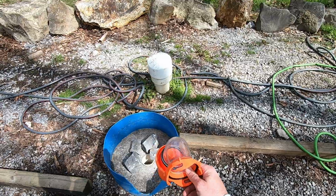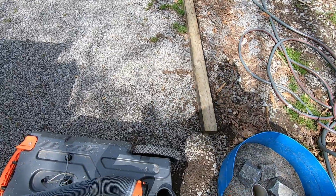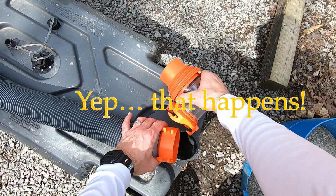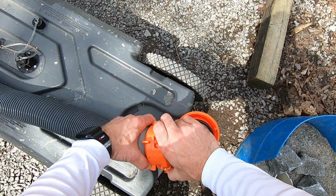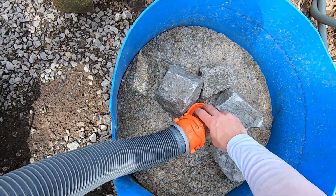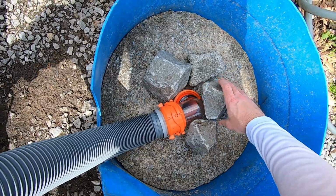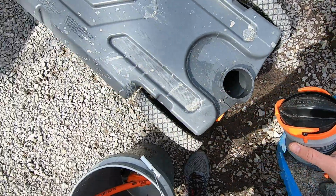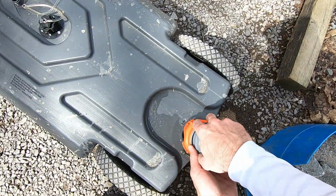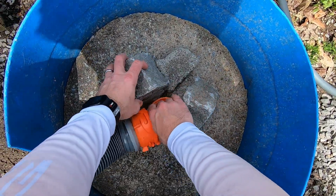This is what goes down inside of the sewer dump. And so on your hose, you're going to have two sides. One's a male side. Oops. And that happens. You're just going to have to watch for it. That side's going to go in here, and usually there's some rocks or something that you can prop against your hose. Go ahead and take this cap off as well and put this side with the female side on the tank. Make sure this is secure as can be.